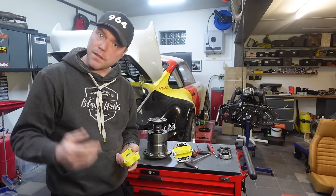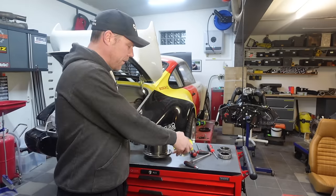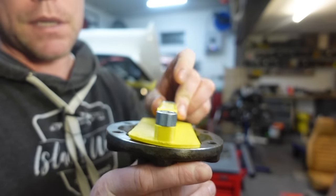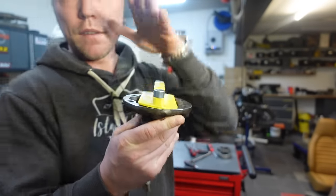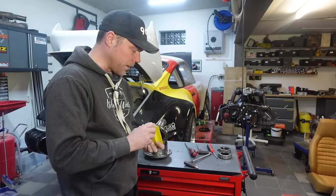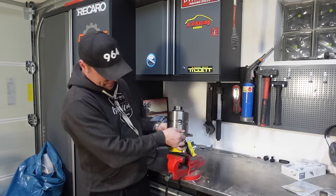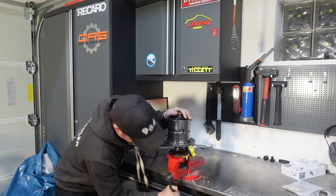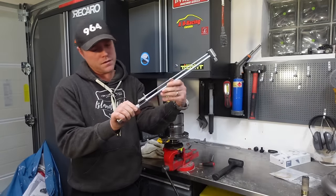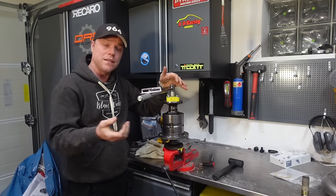Got the LSD put back together with the two drive flanges. I'm going to secure one in a vise using a little 3D-printed tool I designed that grabs onto the two nuts and clamps them securely. I'll put these in my web shop so anyone who wants to do an LSD pre-tension test can get them. Then I've got one of these torque meters with a scale — once you overcome the static friction you can read off the value.